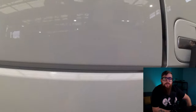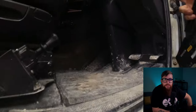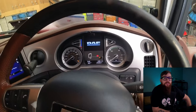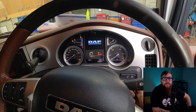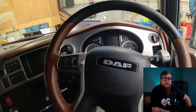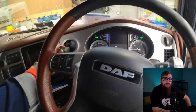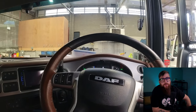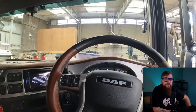We're going to move this vehicle outside for the next step of this diagnosis and carry out a force regeneration. With this controlled regeneration cycle, we can monitor specific system data from the EAS ECU and check it for correct temperature and quantity. The driver has reported constant regeneration while driving and masses of white smoke at low speeds during regeneration, which would be typical symptoms of a poorly performing DOC.